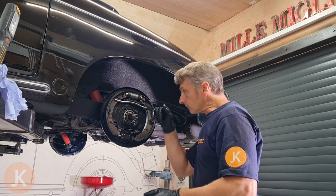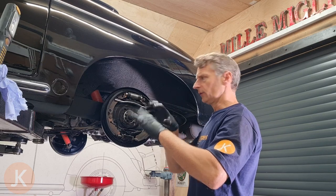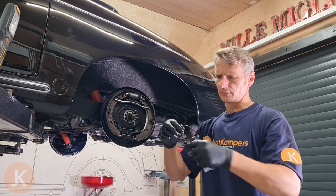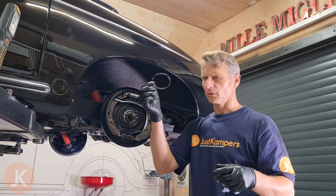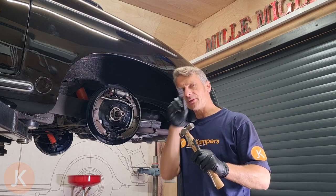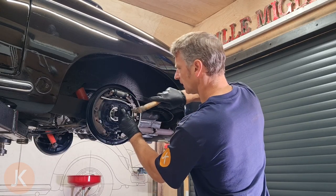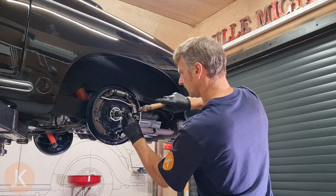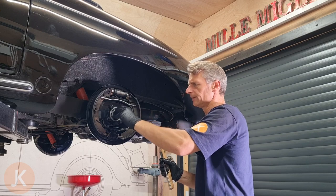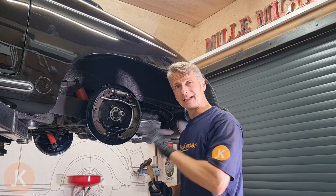I can now get the rear o-ring out, which seals between the bearing and our seal housing. That's the o-ring that goes around the back of our wheel bearing — we're going to replace that anyway. To move our bearing retainer which houses our inner o-ring I'm going to give it a light tap around the face to bring it away from the wheel bearing. That actually looks very dry in there and the o-ring looks very dry, so it doesn't look like we've been leaking oil there.